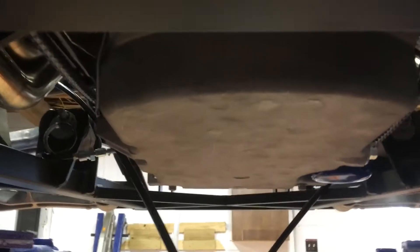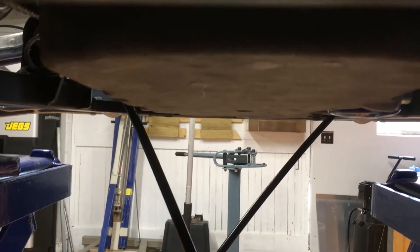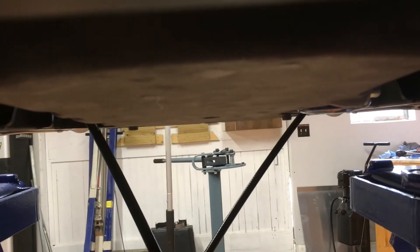Since I'm under here, with the crate motor it comes with an oil pan that sticks down way too low, so I did have to get a different oil pan that's now level with the bottom of the chassis. It's actually maybe less than half an inch sticking down, but that's as high as I can get the motor and transaxle. I'm going to make a little brace just to keep the bolts and oil pan from being the thing that gets hit. That's a necessary purchase with a crate engine — get the shallow oil pan.